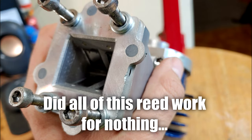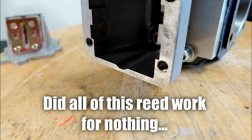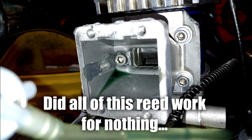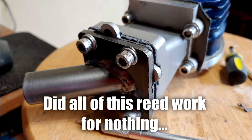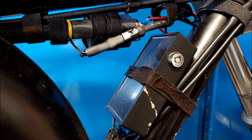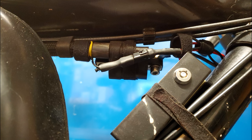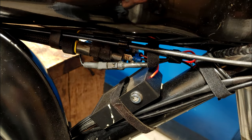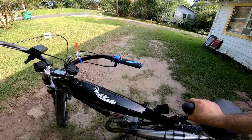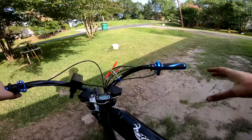I had some time to kill, and in my head I was trying another process of elimination. I got what now seems like the obvious idea to go back through my old footage and try and find out what other things I added to the bike at the exact time this issue arose. And thanks to the catalog of back footage, that's when I found it. The BBR tuning ignition system was the only other thing I added to the bike at the exact same time I added the reed valve. So, we pulled the Firestorm performance system from DLH off of our Phantom 85 and swapped it out onto the hybrid. And just like that, the idle popped right into place and has been perfect ever since.